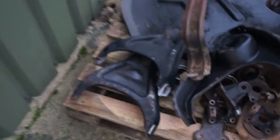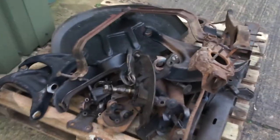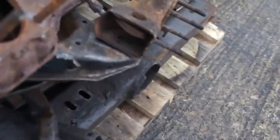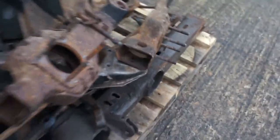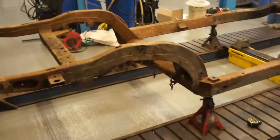We'll scrap the old ones. The replacements — there's the two uppers and the two lowers in there — and this pile is all yet to be steam cleaned, so that's just sat there for the moment. I also noticed one trailing arm is bent just here, but I think I can straighten that out without too much of a problem, so I don't think that warrants a new trailing arm. The rest of the arm all looks okay.